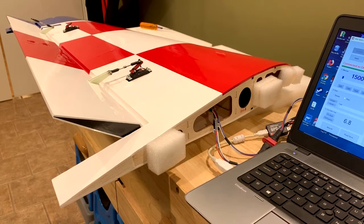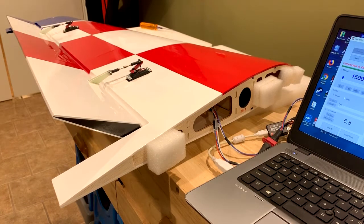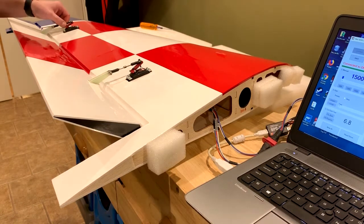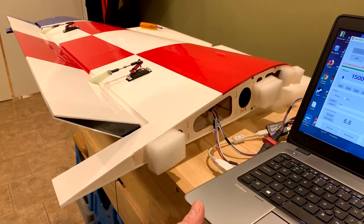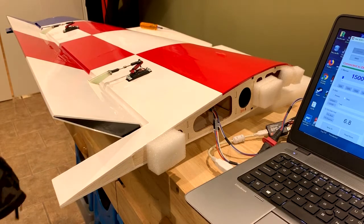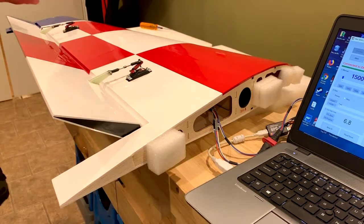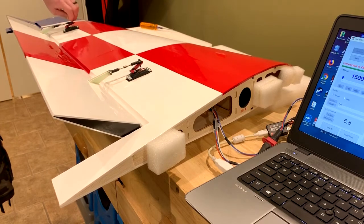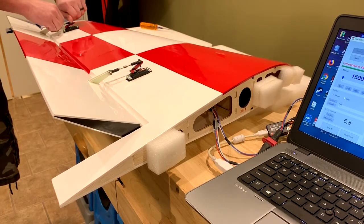So now the radio is turned off, but the servo is still held there right at 32 degrees, and we will go and program this direction of the outboard servo. It's quite a bit more. We'll do another one. Just a hair too much, so now we'll bring it back just a little bit in little increments. I think I want one more. And there it is, butter. Thread's nice and easy, it's not binding. And we know that's the end point.